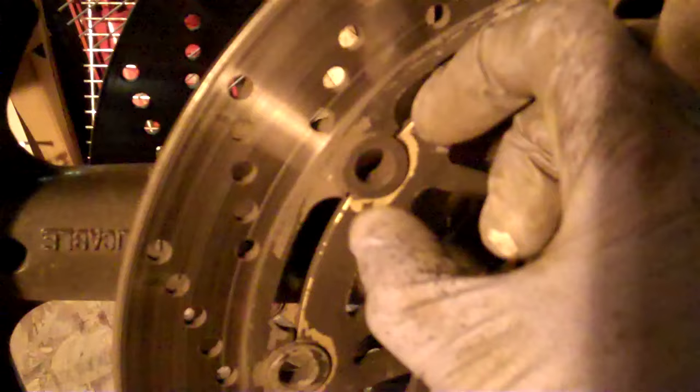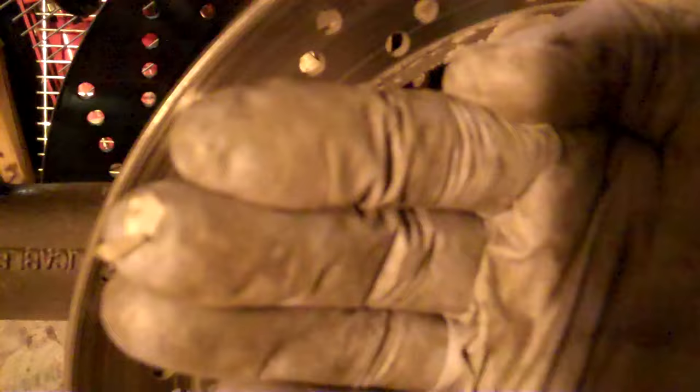You can free the bobbins off without butchering them, and that's what I'm going to show you tonight. There's no salt on the road yet so they're not too bad, but these bobbins do get gunked up. The idea of these bobbins is that they're free floating — they're an interference fit, there is resistance to them, they don't rattle about like Ducati discs — but they do have an element of movement. When that stops, the disc ends up cocked to one side slightly and runs out, so you feel a slight oscillation in the hand lever.